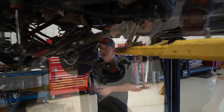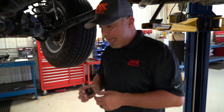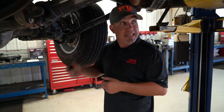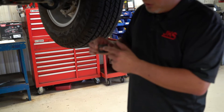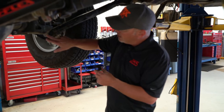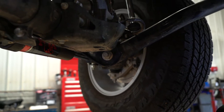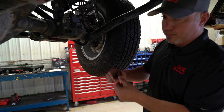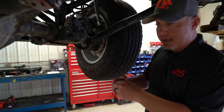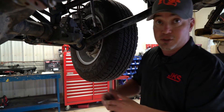So let's go over and take a look at a Jeep with something else on it. Here we are back under a solid axle vehicle — a Jeep — which we're more familiar with. I call this a caster correction plate, an indexing plate, whatever you might want to call it. As you can see, it is square and it has an offset hole drilled in it. Here's a control arm bolt at the factory location on a factory axle — no wizardry here. Depending on how I rotate this, I can make the control arm longer, shorter, or neutral. It's got three positions: shorter than stock, longer than stock by about five-sixteenths to three-eighths of an inch, or a neutral position meaning it's just stock length.